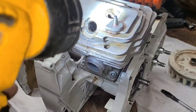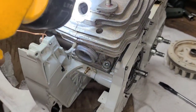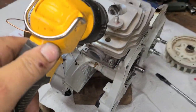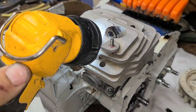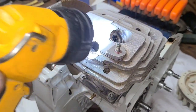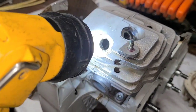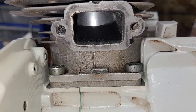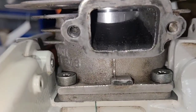Hope you enjoy. To do the exhaust timing you want a flashlight — I used my DeWalt one from work. You want to shine it on the same angle as the spark plug hole, so prop it up with something. That's how you get exhaust timing numbers. I've already gotten all the numbers, but in the interest of time I'm going to streamline this video.